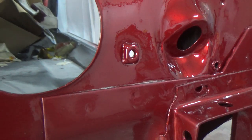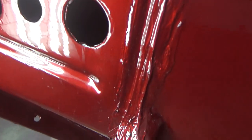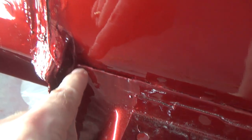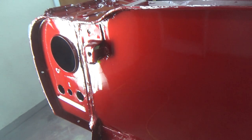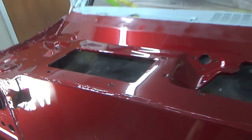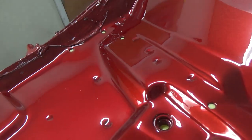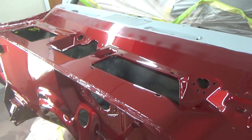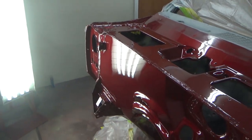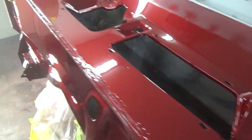These edges had a hard edge on them here. I did a soft edge here, along with a seam sealer. So again, you can't see anything there. There's no edge. There's a hard edge across the top of this, but you can't see it, so it doesn't matter. Very nice. I'm real happy with that. Way less trash than before. I'm not trashless. Still some larger chunks up in here, but for the most part, that was good. As I was saying before, this is cut and buffable, where that other heavy, chunky stuff was just no good. So I'm happy with that.